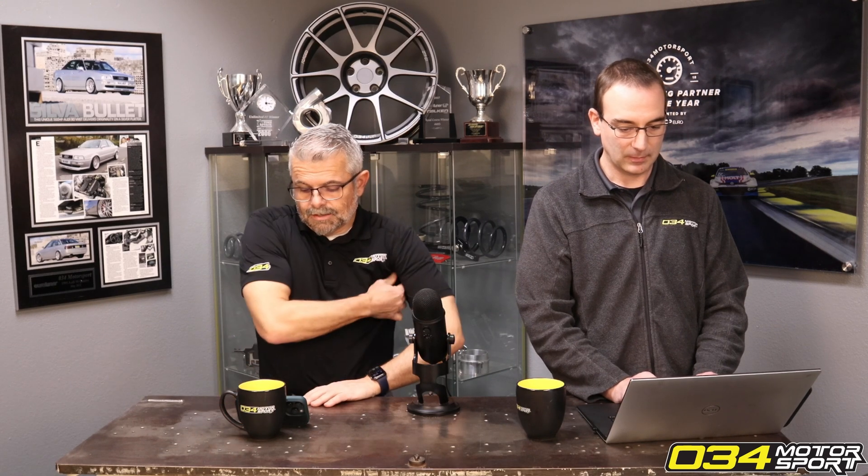You will need the four-bar MAP sensors that we list on our site, and an ethanol content analyzer if you're going to run any of the E-blended tunes — you don't need that if you're just going to run pump gas. The 93 octane is really nice; you're talking almost 600 horsepower and 596 foot-pounds of torque on 93 pump gas, and that's a fast car. We strongly recommend running a good intake like our X34, and the other required modification is an intercooler kit.